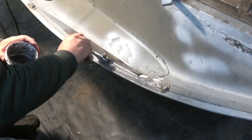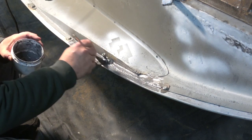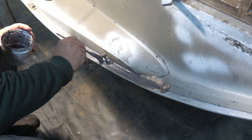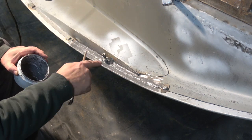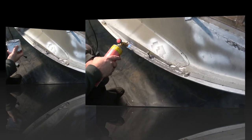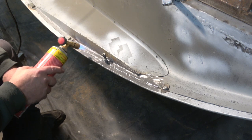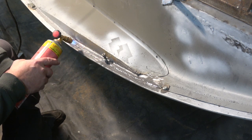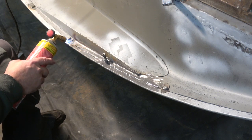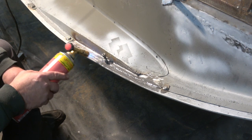Drag it around the back, and then I can clean it and drop the lead in there. When I put the lead in I'll let it go soft and then I'll take this out and this will make its own thread hopefully. What you'll see is the tinning compound will start to go kind of a silvery colour, like it's burning almost, and you'll see it drying up. Hopefully that's coming on camera now — you can see it drying up as I do it.